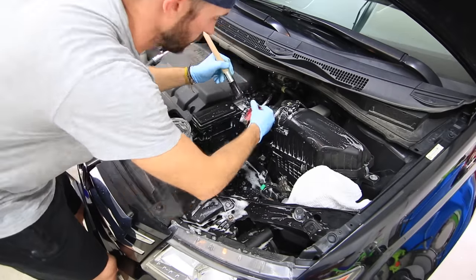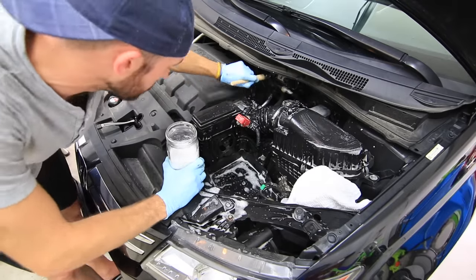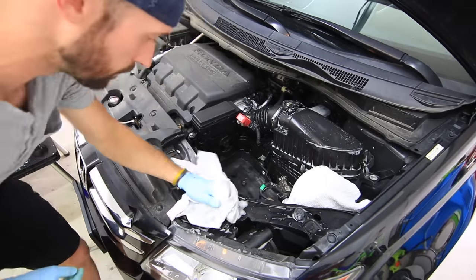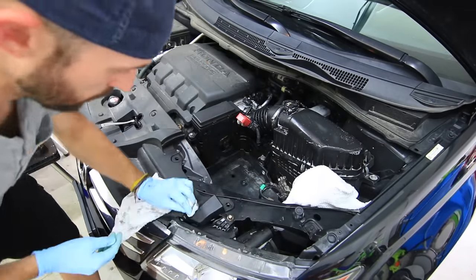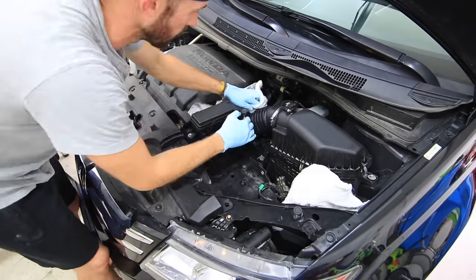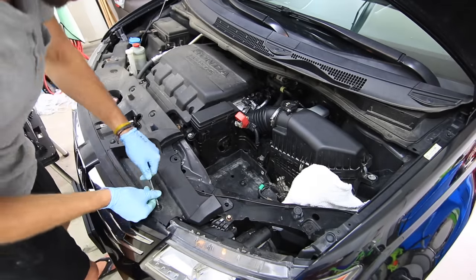The real reason you want to work in a small area is because you're not using a ton of water and you don't want that soapy water and dirt to re-adhere back to the surface and dry out. Before you get too far along, grab your towel and wipe down those surfaces — dry up that soapy water and lift the dirt off the surface. Repeat the same process in the same area if you still have grease left over. You can always use the engine degreaser or brake cleaner on metal parts if you need a more serious cleaning, but Dawn and the brushes should be sufficient for most cases.